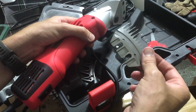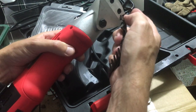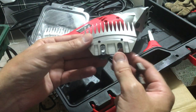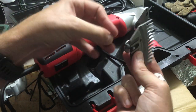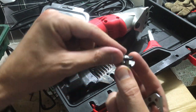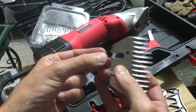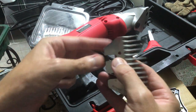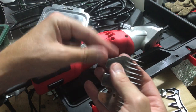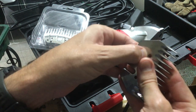Once you do that, the long blade comes off. The small cutting blade is also going to come off because the arm up here can no longer hold it against the long blade. One thing to mention is there are a couple of black washers — I just dropped one of them. What they do is they connect to this long screw and stay in between the long blade, basically helping the blade stay tight against the housing where the motor is. You'll want to make sure you don't lose those. When you put it back on, you're going to want to make sure those things are back in place.